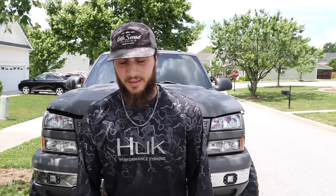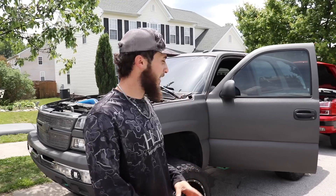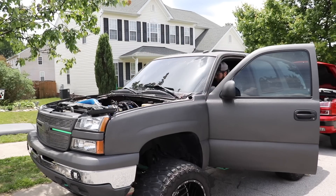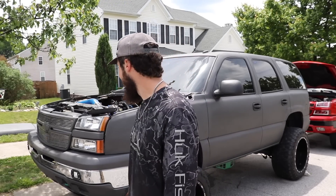Next day — I think I missed a couple of grounds. We have to try to figure out what we did. I heard it could be bad from the motor being locked up and me trying to start it when it blew up. There's a lot of different things that could be wrong, so what we're going to do is start off by disconnecting the battery, take our time today, look over everything, and make sure all of our grounds are good. I actually missed the main ground for the battery — we're trying to match trucks back and forth. I think I got it in the right spot. The headlights are back off, oil pressure's back where it needs to be, and I think she's ready to start.